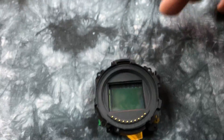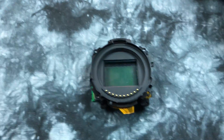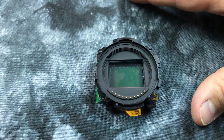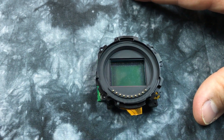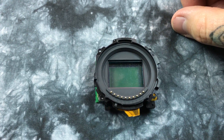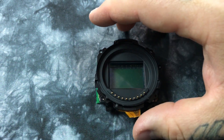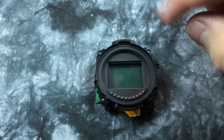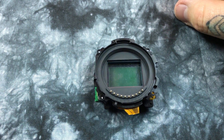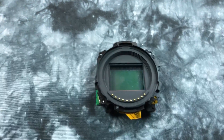Let's take a look at the sensor — this is a 16 megapixel sensor on a Fujifilm camera. Of all the countless cameras I've taken apart — Nikon, Canon, several Sonys — the reason Sony tells you not to clean your sensor, if you own something like an A7, is that the contacts are exposed. If any liquid drips on there it's going to damage your sensor.